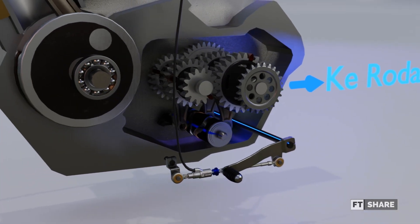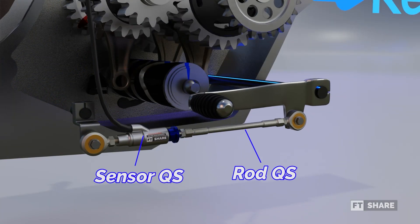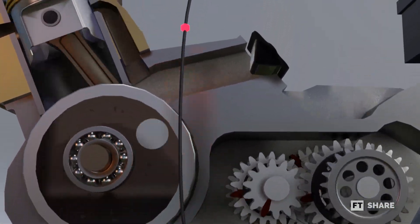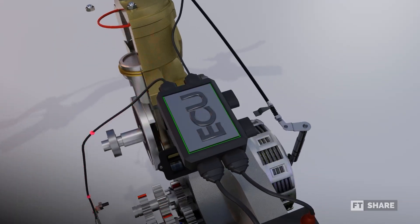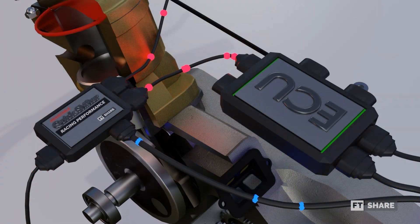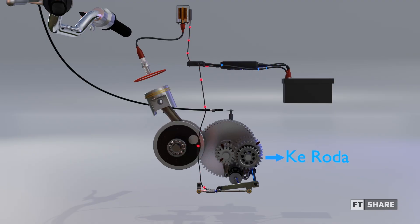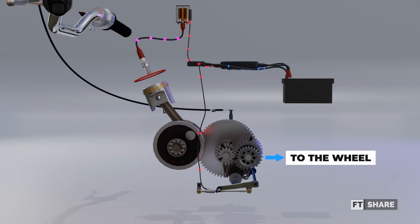The quick shifter is a device that functions almost the same as clutchless shifting. It is positioned below the shift lever and directly connected to it. When the shift lever is moved, it will activate a rod connected to a sensor in the quick shifter unit. This sensor sends a signal to the ECU, which is already integrated with quick shifter technology. For ECUs that are not yet integrated with quick shifters, additional devices are needed. If we apply an aftermarket quick shifter, we will receive an additional module that is placed between the quick shifter sensor and the ECU unit. The signal sent from the quick shifter sensor is processed in the ECU and instructs the ECU to stop the ignition process, meaning the coil will stop working. This halted ignition process will effectively reduce engine speed until the shifting process is successfully completed. Then, once the shifting is finished and the rider releases pressure on the shift lever, the signal sent from the sensor to the ECU and the coil will be stopped.